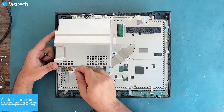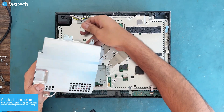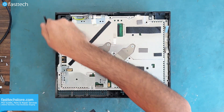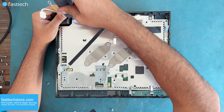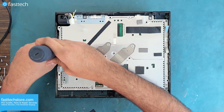There's a cable at the front here that we can lift up, and then the power supply can be lifted. There's a pinch connector at the back that can be removed like this. Let's take out some of these dust bunnies from the system. Next, we've got to remove this grounding screw. There's a long bolt hiding in here that we must remove. Now the rest of these screws must come out.